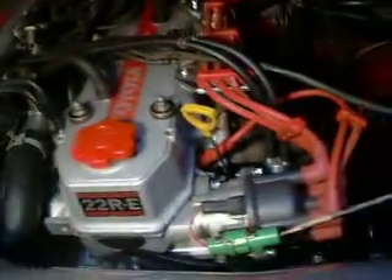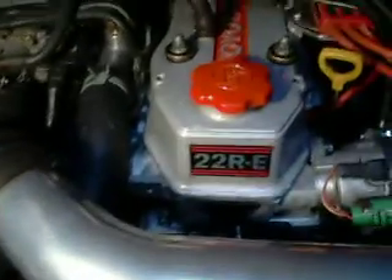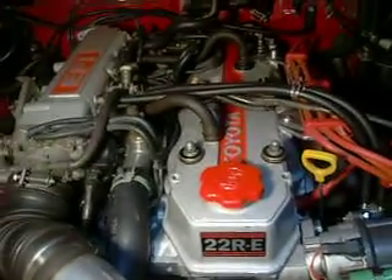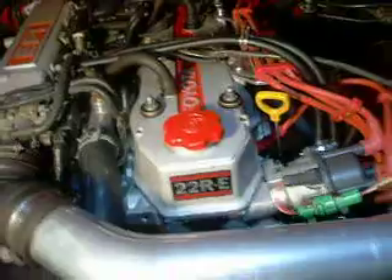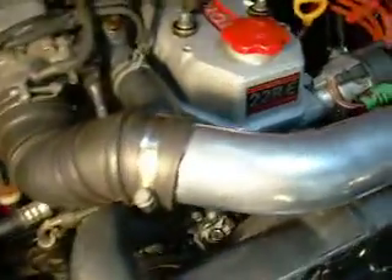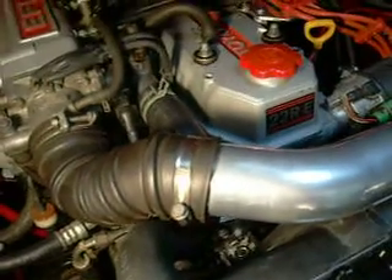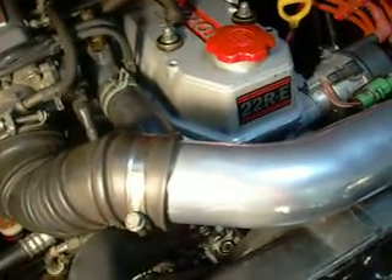The timing — the distributor — I got it in perfect and I've had it marked. It basically went exactly to eight degrees, which is where I found it. It runs best with this cam, the 261. I'm hearing a little bit of noise only at an idle, so the only thing I can think of is the chain.